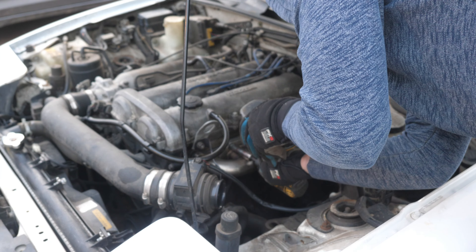The welds turned out fantastic. Here is that elbow all nice and welded - it basically misses that power steering reservoir and it's a straight shot right into that hole, which is exactly how we want it. The hood won't close over the two and a half inch piping, so what we're going to have to do is splice in some smaller diameter two inch piping so the hood closes.